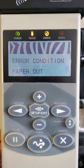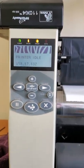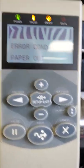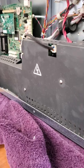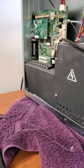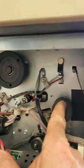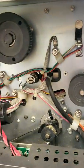You can get this error for a number of reasons, but in this case if it gives you that little sound it just seems like it's running in neutral without getting any traction. If you take the side panel off — be careful because there is some high voltage there, never take that off while power is still applied — with three screws you can take the side cover off. If you go in here and look, the main drive belt that's supposed to go across this sprocket has basically disintegrated on this unit.